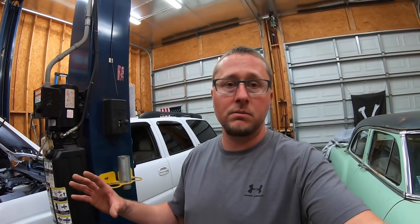So Z71s came with 373s. And then I also upgraded to a Detroit True Track differential. I was going to go with a locker, but because it really is just a street-driven truck, I went with their True Track differential. And it's been flawless as well. So I set up the gears in another video, which I will put at the end of this video. You guys can check that out as well. That basically does it for the build of the Tahoe.